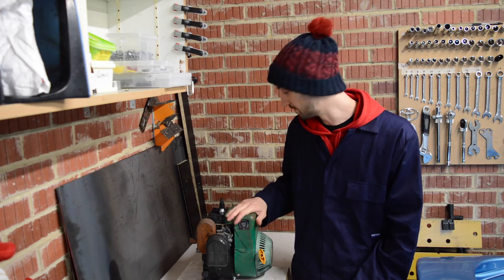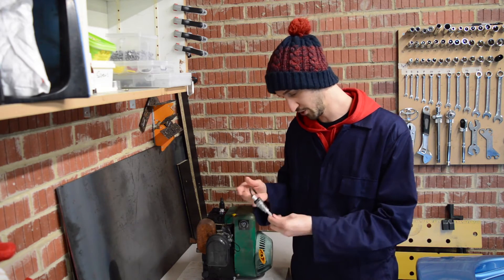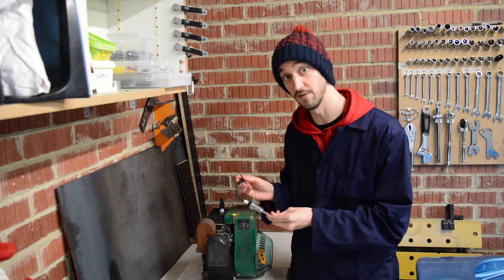Here's the little engine that refuses to run. I've picked up one of these little spark plug tester lamps that should glow up every time there's a spark, so I'm going to wire this in and see if it glows.